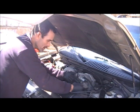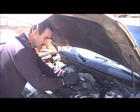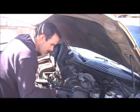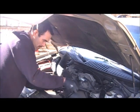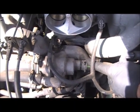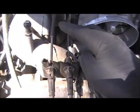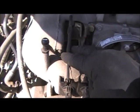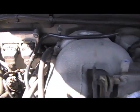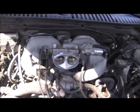You'll also have to undo your breather line and an air charge temperature sensor right here. You want to disconnect your hoses — all of them that pertain to the cooling system: radiator hoses, throttle cables, cruise control, a couple of your emission hoses on this side. Disconnect all those and get them out of the way because the intake will be coming off.